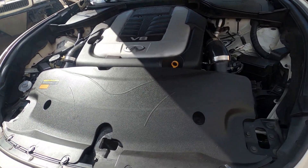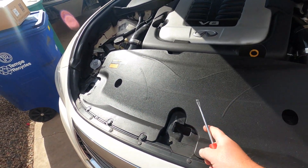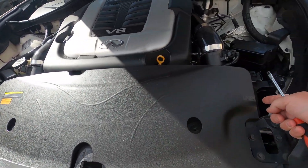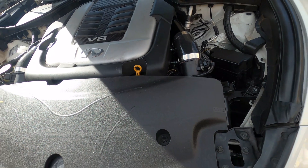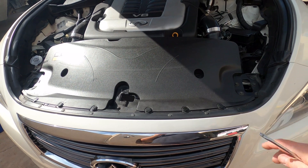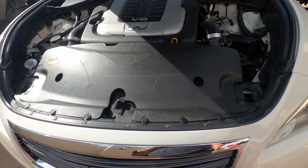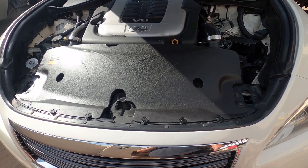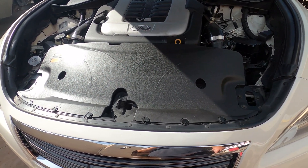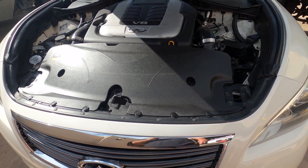To start the installation, we're going to take off this air cover here, which is the cold air duct. This actually scoops in cold air — you can see there are lines that nicely sculpt that towards the air boxes, which allows the engine to get nice cold air. On the dyno, this cold air ducting did not show any signs of restriction in either the MAF reading or the MAP reading in the manifold, so it's going to stay for performance reasons. Out here in Arizona, we need all the cold air we can get.